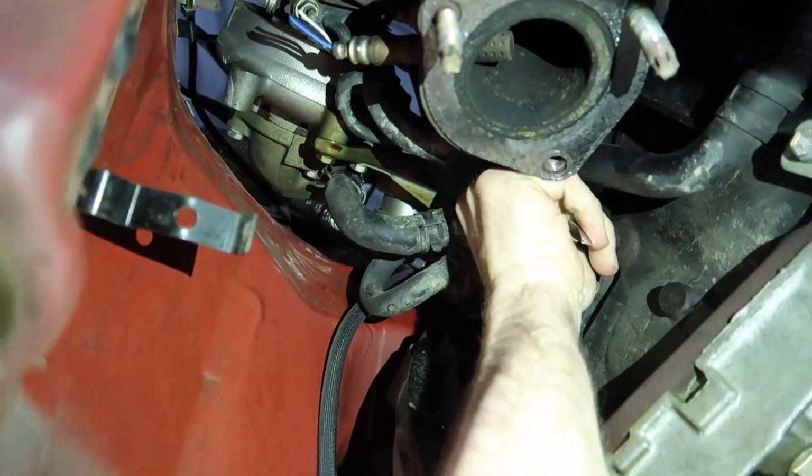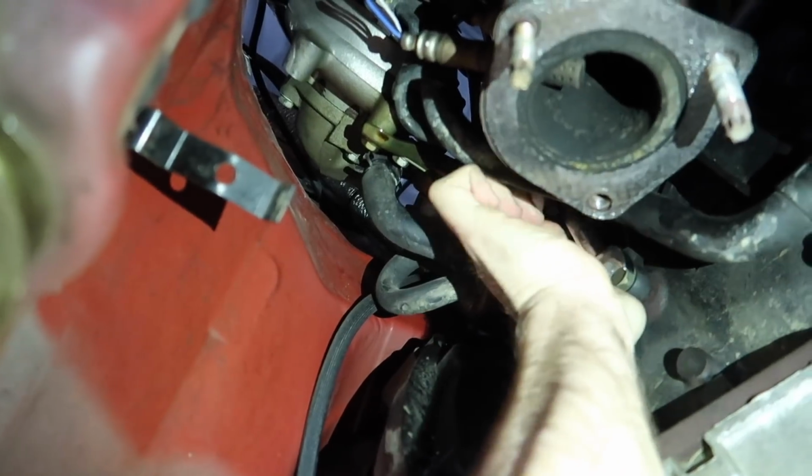So the first thing we did is put the car up on the lift. Look at the second turbo. You can see on the left-hand side of the turbo how it's covered in oil. Now, I didn't mention this yet, but the turbo in the front doesn't feel blown. It actually feels pretty decent, and there's no sign of oil in it, which kind of defeats everything I've been saying, that I think the turbo's blown. So I wondered if the second one is destroyed. The first thing I did was look at that rear turbo, and what do you know, it's literally covered in oil. So we're gonna take this apart and see what it's all about.